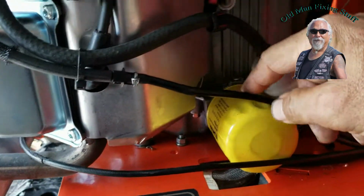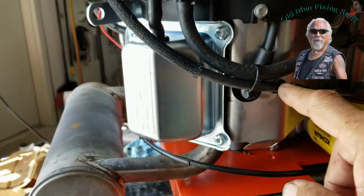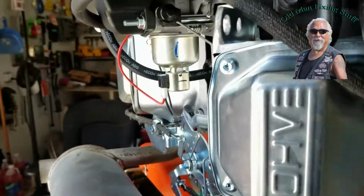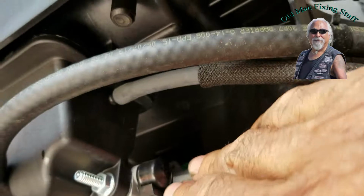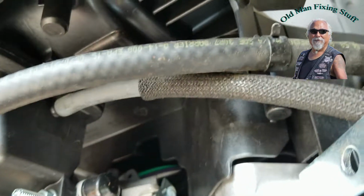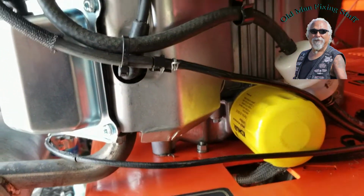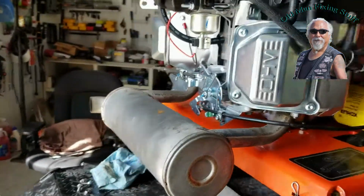Right here, you can see it, is a vacuum line that goes to the gas lines. I had to extend it from here because it's where it ended. The old one went right into here somewhere. I put a longer one in, which came in under here. You see right there is where it went in to the inside of the carburetor. So that worked fine. That was the only thing I had to do, was extend that.